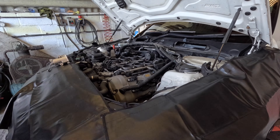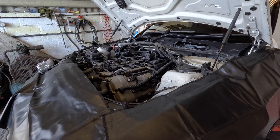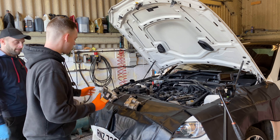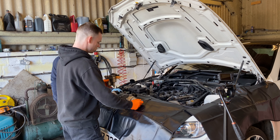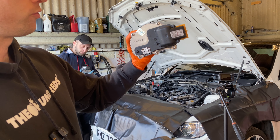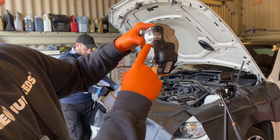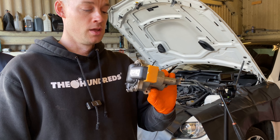These next parts are really straightforward - you've just got to lift the wiring loom up a little bit, move it out the way, make sure you've got a magnet. There are four 10-mil bolts that come off and the actuators literally just lift off. We've got the actuators out now. Comparing them to the new ones from Jason - the new ones come with void stickers and a lifetime guarantee warranty.